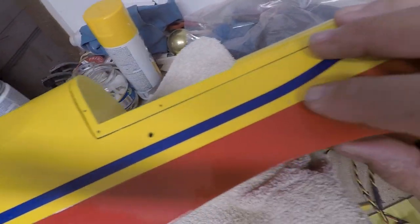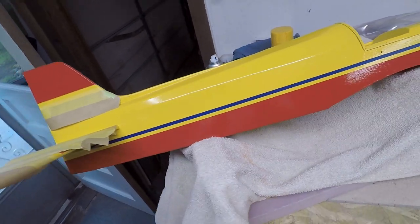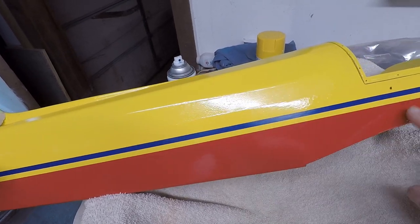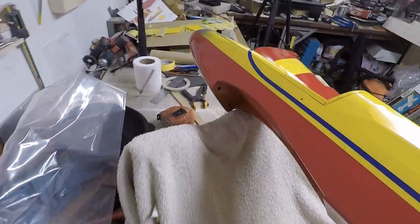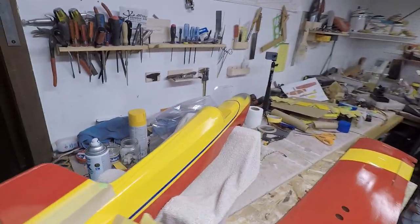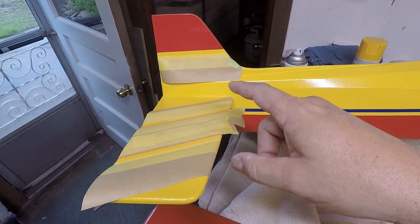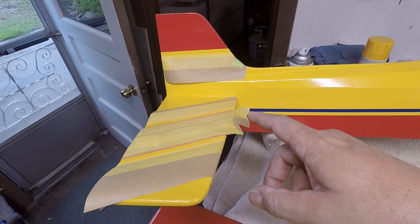Right about in here, this paint will pop — that popped with that kind of tape on it. So I've got to be very careful when I'm pulling this off. Don't lift it up. You've got to bend it over and make it really sharp so that you're not pulling it straight up — you're actually bending it over and folding it back on itself. That should get rid of all that. It's a smart way to take the tape off. This side over here is already all set up except for the final tape. I've been doing this for almost three hours already today — it's probably going to be about five hours of prep for a few minutes of spraying.